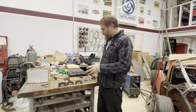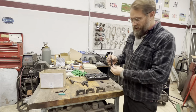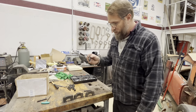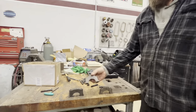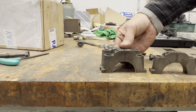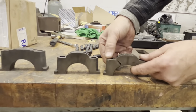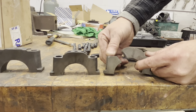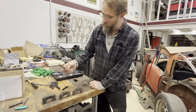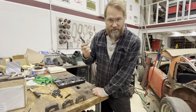While I prefer to put in all ARP mains and head studs, ARP only makes the studs, which is what I've always run in the past. But in order to run the studs you have to run the earlier main caps, and there's a big difference in height - the late main caps are a lot taller with more meat. Since I've done this to two main caps now, I'm going to go ahead and stick with the heavier mains that come in this motor, which means I have to go with the bolts since ARP doesn't make the bolts.